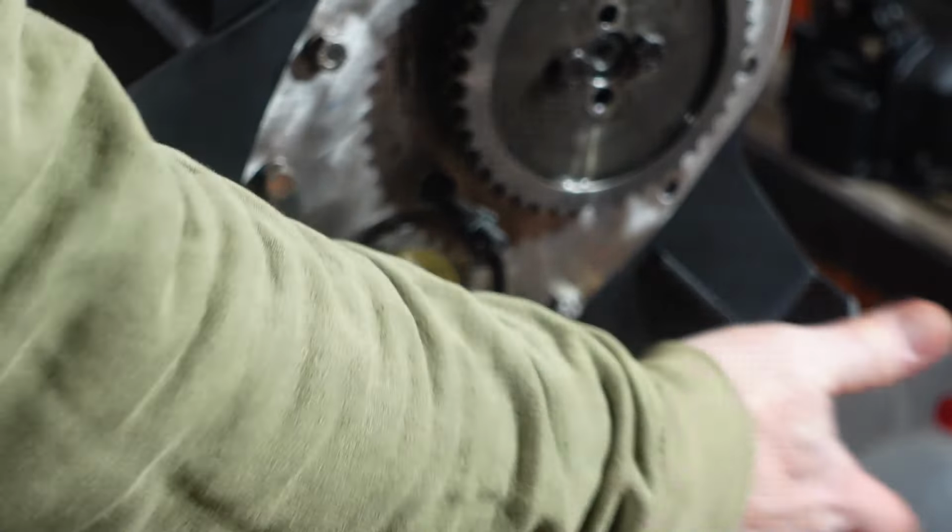All right, so that's driven home. So now all it really says is take the sprocket and align it here to make sure you have essentially a relatively flat edge. You go across the gear to the gear, taking it a couple different spots here just to try to get a nice average.